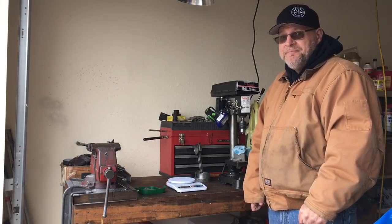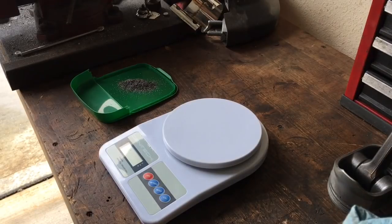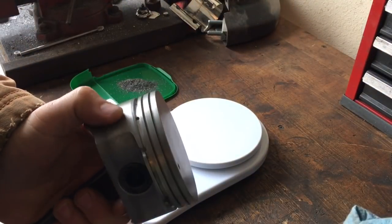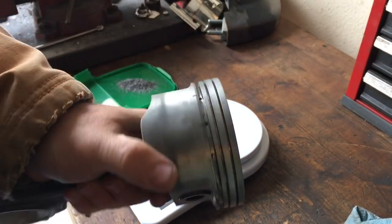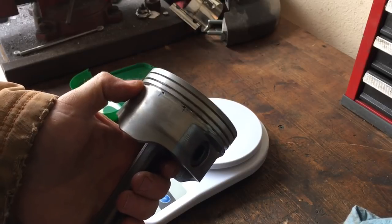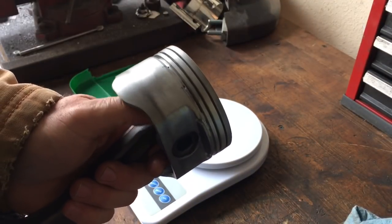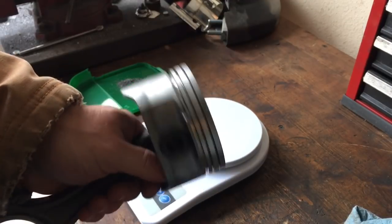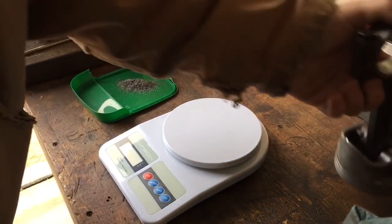So I'm going to bring you over here a little closer because I'm absolutely dumbfounded at the results. All right, for the people who may or may not even know what I'm talking about at this point, we're talking about adding these 3 holes, 1, 2, 3, to each side of this piston in the oil control ringland to aid in evacuating or draining the trapped oil behind the oil control piston rings on an LS piston. This modification will apply to several different manufacturers or makes and models, including GM, Toyota, and a few others if you just do a little research on the internet. But I just wanted you guys to be reminded what we're talking about is these 3 holes that I added to both sides of the pistons going into my Turbo 4.8.